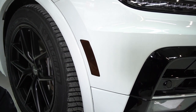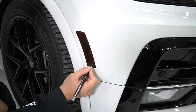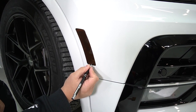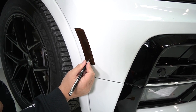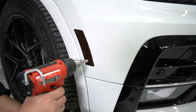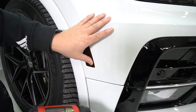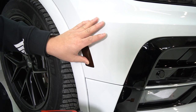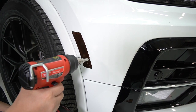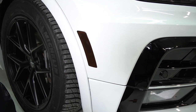The last thing you're going to do is mold the vinyl to the imprint on the marker by taking a threading needle — I'm using a vinyl puncturing tool — and making a bunch of little punctures all around the area where you see the writing. Then take a heat gun, warm up the area, keeping the heat even and not concentrated in one spot. Push down and mold the vinyl to the lettering. Also do a heat treatment all the way around the edges to make sure everything is secure. Now you have a tinted side marker.